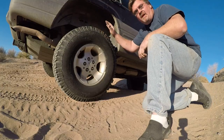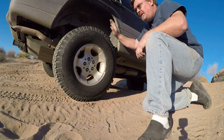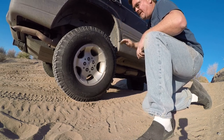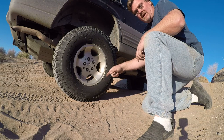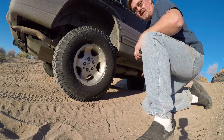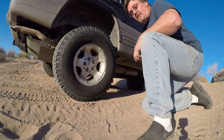I'm going to go up a hill that has some big cross holes, so I can get both tires digging on opposite sides off the ground and make that locker really work. I found a spot where this rear tire has absolutely no weight on it — front end is in a hole, and this one, as you can see, is fully extended with no weight at all. If this was an open differential, that would spin and I wouldn't go anywhere. Right now the only thing driving me is that other rear tire, because the front end is still open and that one's in a hole, so that would spin too. We're going to go ahead and take off and see how that locker works.